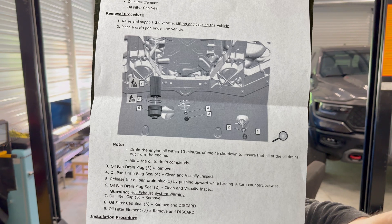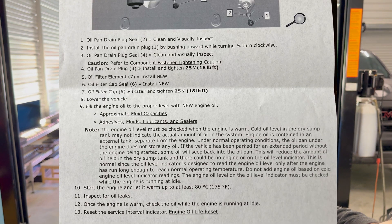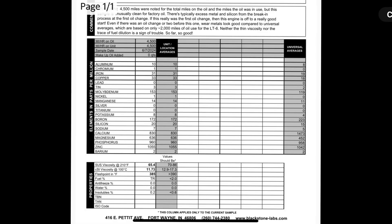We are also going to do an oil analysis with a company called Blackstone Labs. What they do is you send them your oil and they do an analysis on it — basically they look at what metals and things are in the oil, sometimes fuel types, lead, those kinds of things. They come back and say hey, this is normal or abnormal. It's nice to get a baseline on this engine so that moving forward, if I start to have issues, the first place you're going to see it is in the oil, well before you hear it. By the time you hear something, it's too late, but you can catch a lot of things early by using the oil.